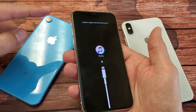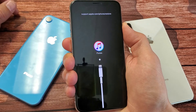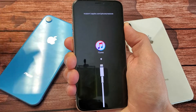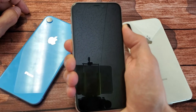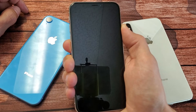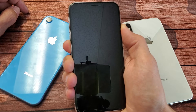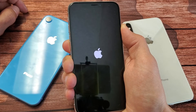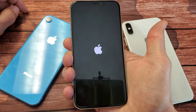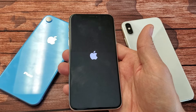Follow me: volume up, volume down, press and hold the power button. Don't let go of the power button until we see that Apple logo. I'm still holding on to the power button — you got to wait. There it is, Apple logo. Now I can let go, and now my phone should boot into the regular OS.